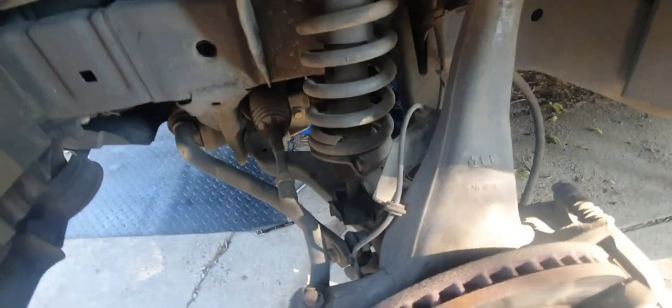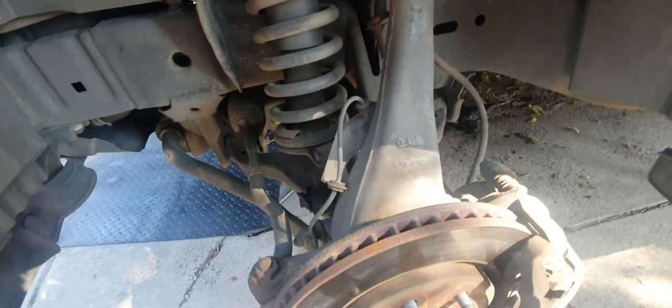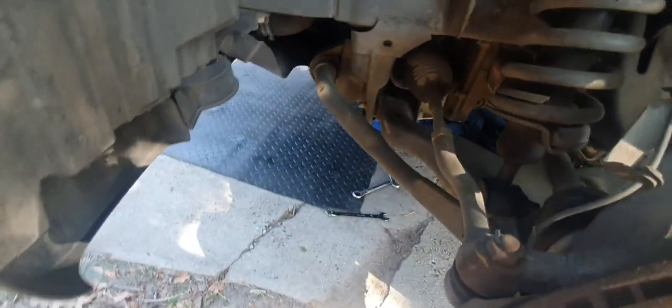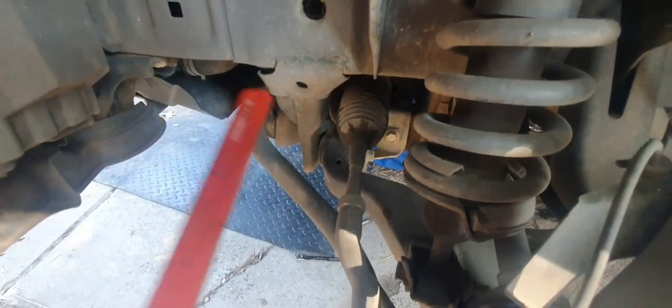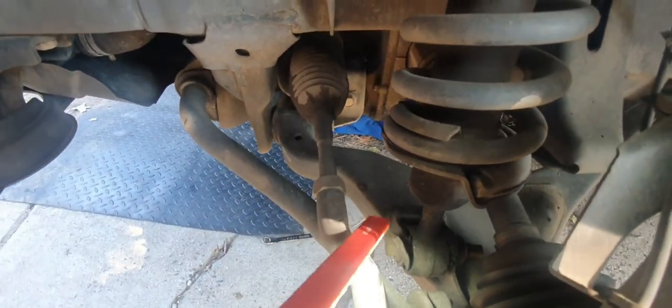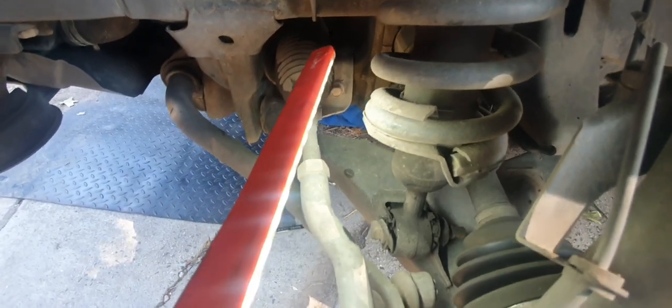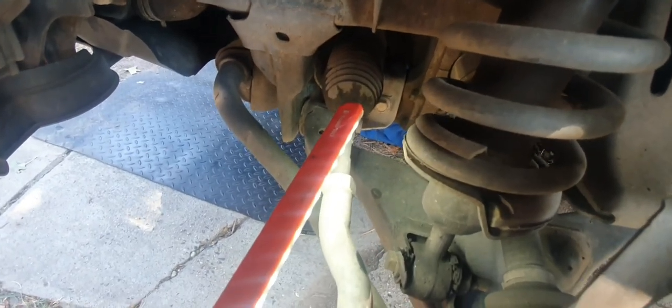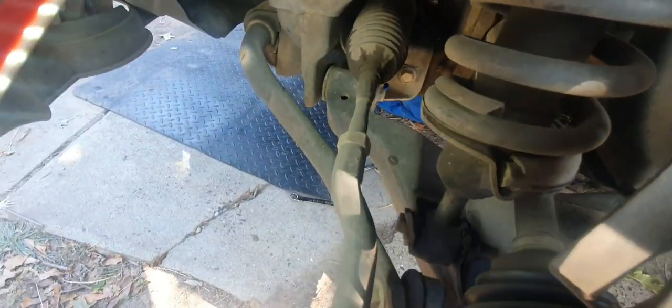We've got the left hand front wheel off. So first thing we're going to do is a visual inspection. We're going to look at brake hoses, make sure there's no leaks, they look all right, they've not been rubbing, all that sort of thing. I think I found, I'll get a light. See the bottom shock rubber down there? That's chopped out, so we'll have to get a new rubber for that. So that can go in our list. And that'll quieten the noise down.